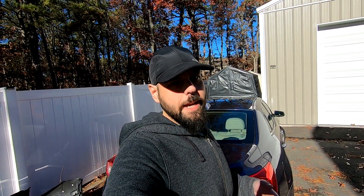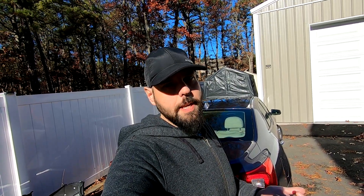Hi everyone, welcome to Dave's World. My friend Mike is having a problem with his Chevy Cruze. He changed his water pump and he's having some overheating issues because his engine is air bound. I decided to make a quick video to show him how to bleed the air out of the system and fix that air bound problem. What's happening is the antifreeze, instead of filling up the whole engine, is leaving an air bubble that's not allowing the antifreeze to cycle — it's boiling the antifreeze and creating steam.